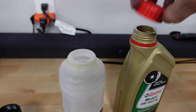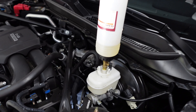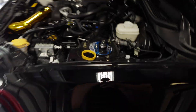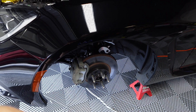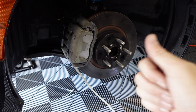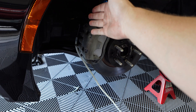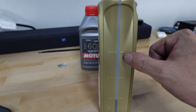We're just going to top this off. All right, I believe we're good to go. Put the wheels on, tighten up the bleeder, then pump the brakes. When you first hit the pedal it's going to feel spongy — a couple of pumps and you should be good. If you still feel like it's not giving you feedback, go around and check your bleeders to make sure nothing is leaking. I used about 500 milliliters total.